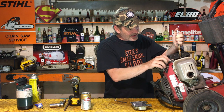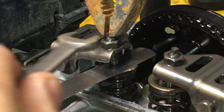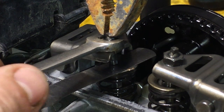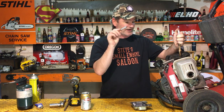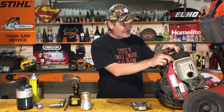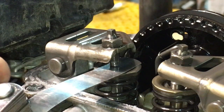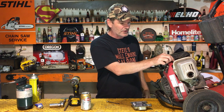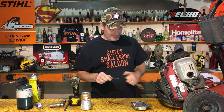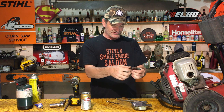Leave that there and hold it with your pliers. Take your 9mm wrench and tighten that jam nut back up without moving your pliers. It doesn't need to be super tight — just nice and snug so that center pin can't move anymore. Once you do that, run that feeler gauge again. If it feels a little loose or tight, just loosen the jam nut and do it again until you get that slight resistance as the final result. Same thing on the exhaust side — switch to your next feeler gauge, which is 8 thousandths of an inch, and do the same procedure.